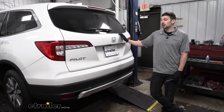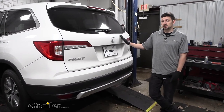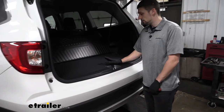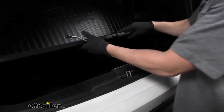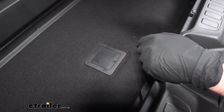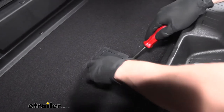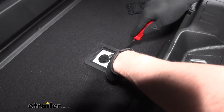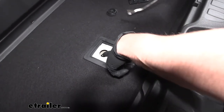To start the installation, the first thing we're going to do is open the rear hatch because we need to access the inside to lower the spare tire, which will then allow us to raise the hitch up into position. There's a button on the underside we can press. Inside, there are a few panels we need to remove first to get to the nut to lower the spare tire. We release the lever on the outer panel and pull it out of position. Then we work our way down to the center hole, using a trim panel tool to pry off the cover and remove the rubber plug, exposing the bolt to lower the spare tire.